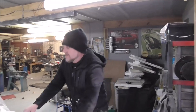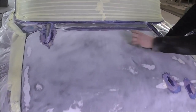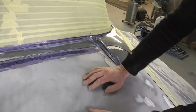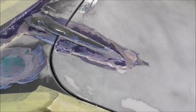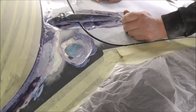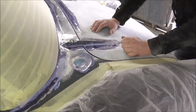We've sanded down this boot and there were a few small problems. Up here as I thought there is a bit of corrosion - I've ground all that until it's shiny and then added the same rust treatment as on the roof, and around these hinges as well which are actually moulded in. Working on a custom is never very straightforward, so everything is moulded in. I can't really get those off without embarking on a massive job, so I've ground all that back to bright steel and made all that good. Where the filler cap was removed it had cracked, but we can fibreglass over that.